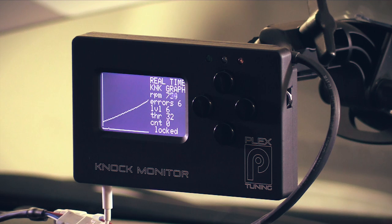Our next screen is our knock threshold table and the line that you can see on the screen here is a threshold — if the knock noise goes above this threshold at any point in the RPM range, it will detect detonation. The first step in setting this up is to do a run on the engine with safe, retarded ignition timing and make sure we've got no knock, and then we can adjust the threshold to suit the particular engine. While we're running the engine, we can listen to the headset and make sure we aren't getting any knock.